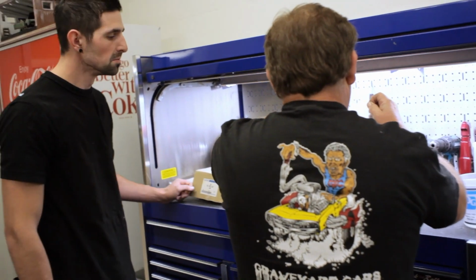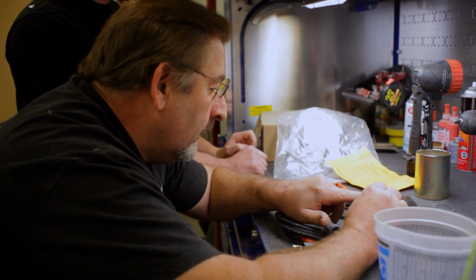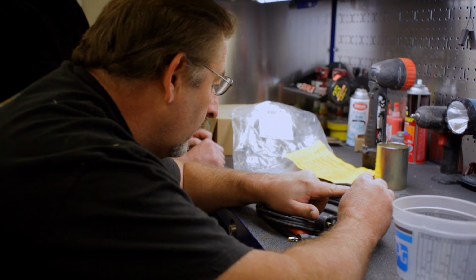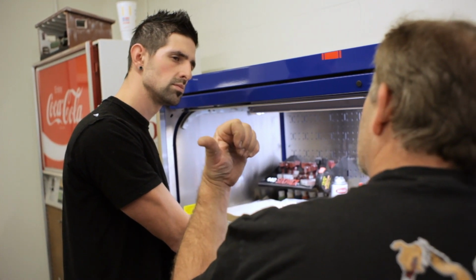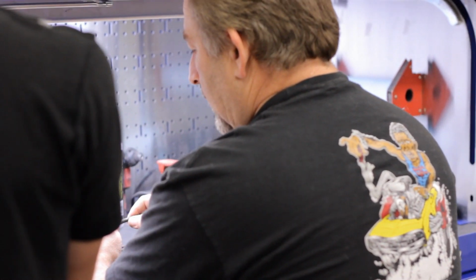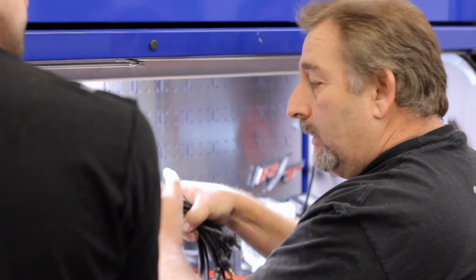Okay. You see down here on this end, the 3Q-69? Right. These plug wires were manufactured in the third quarter of 1969. July, August, and September were the third quarter. Right. And that car was built in August. So most likely that's the correct part code for that car. Okay, the third quarter of 1969. So my guess is these are the correct date-coded replica spark plug wires for that car.